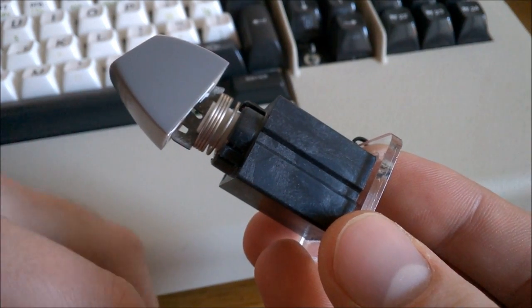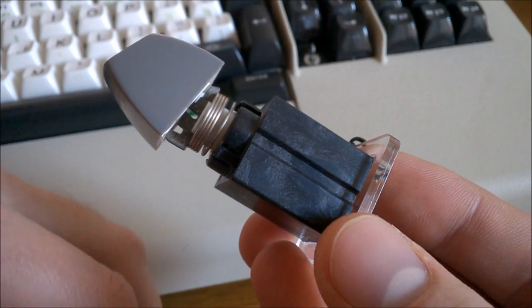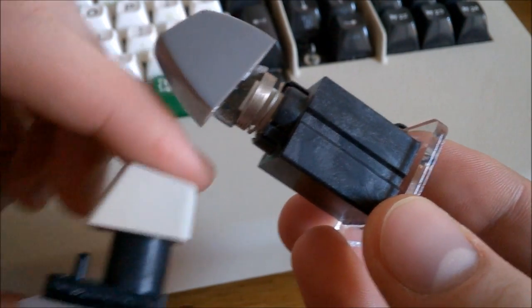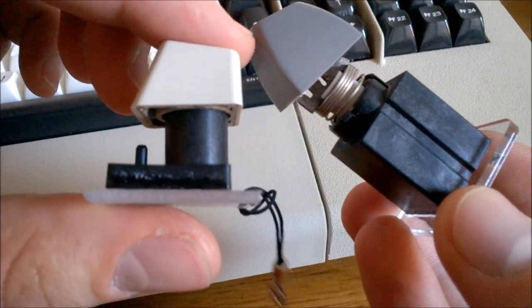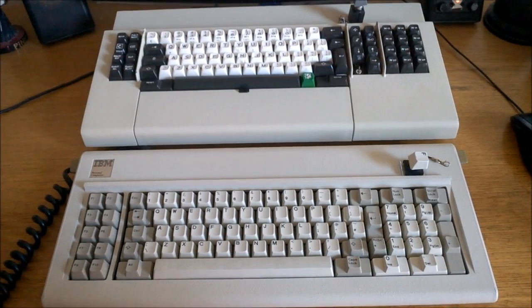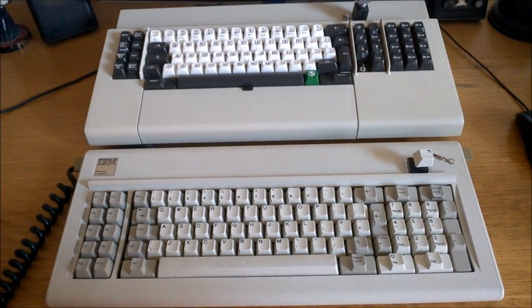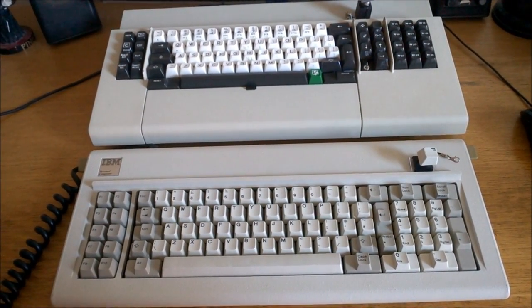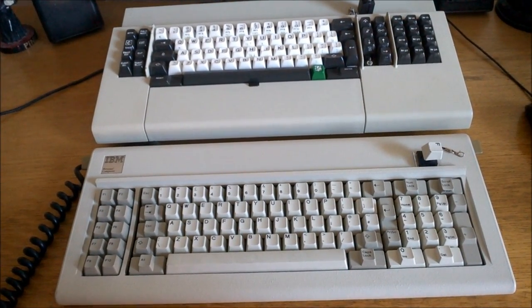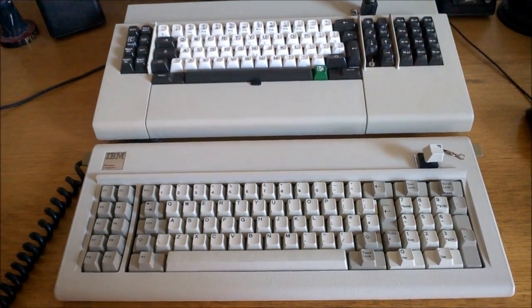There are also discrete switches, and apparently IBM sold replacement modules to service your board with, while buckling springs are just flippers held in a barrel plate. It's a very, very expensive design, and the sensing assembly was somewhat vulnerable to dirt and dust, which is why they later replaced it with the much cheaper, simpler, and less dust-sensitive buckling springs in the Model F.